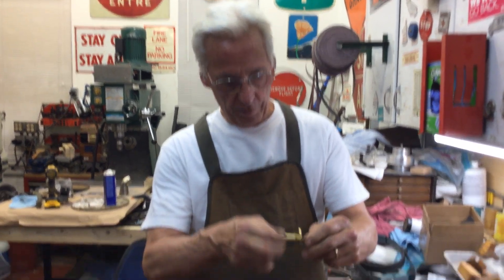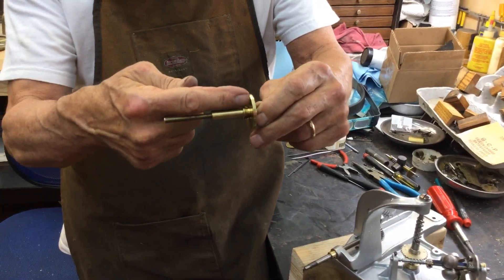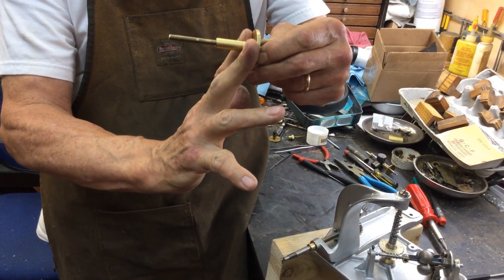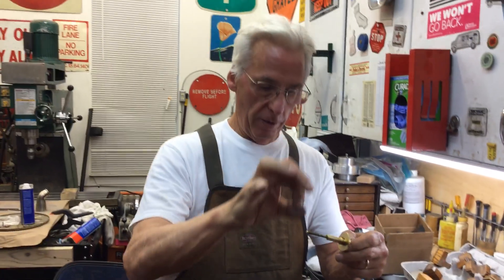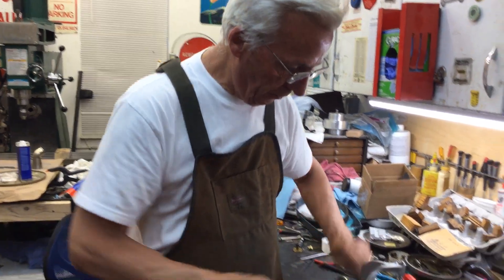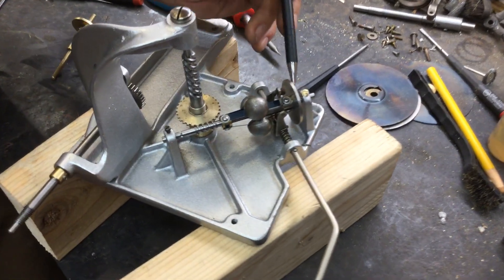I want to show you some snags about the Victor 5 motor and the assembly of the governor. Usually on a governor, you have the flywheel part here and the leathers hit here. You usually have one piece that comes in, or you have a yoke that comes in like this. But on these early Victors, you have this round piece like this, and it fits in here like this — I'll show you right here. You see how this fits in here with the leathers that hits the flywheel.